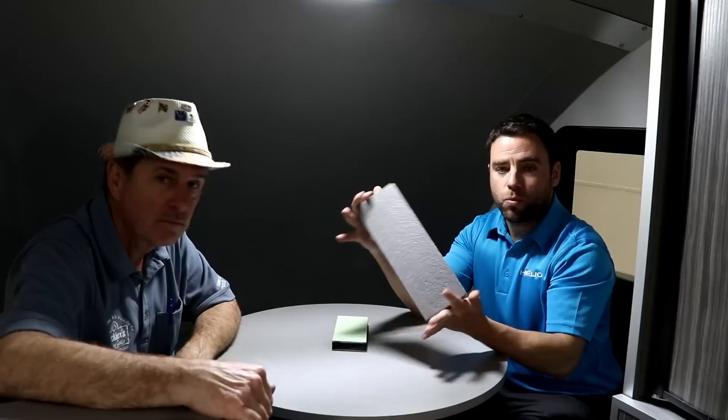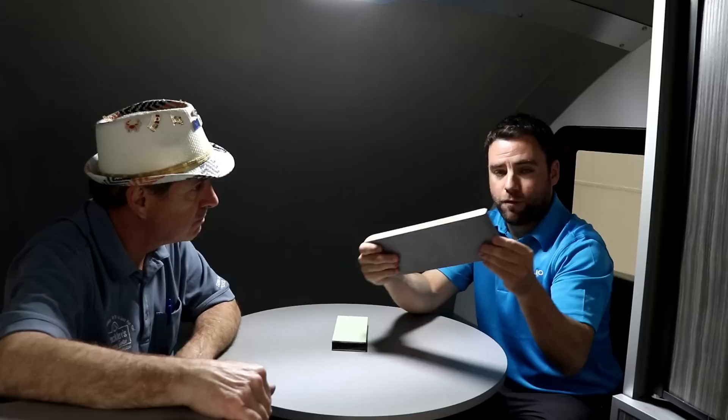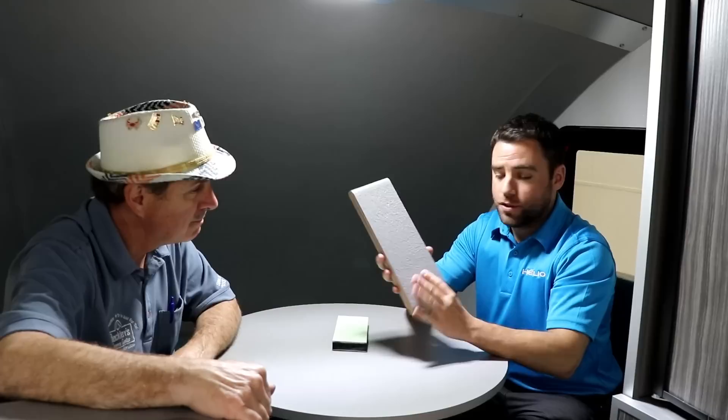For the floor, we have a floor all wrapped with fiberglass. It's six-ply plywood, three-quarter of an inch, and we put fiberglass everywhere. So it cannot rot with time, cannot have moisture on your floor, so no maintenance to do. In ten years the floor is going to look the same. For those of you that may have had RVs in the past where you had a soft floor, there's much less chance of that happening here.